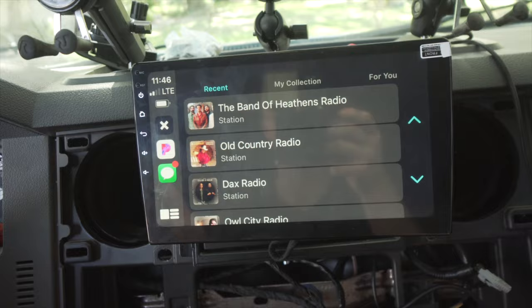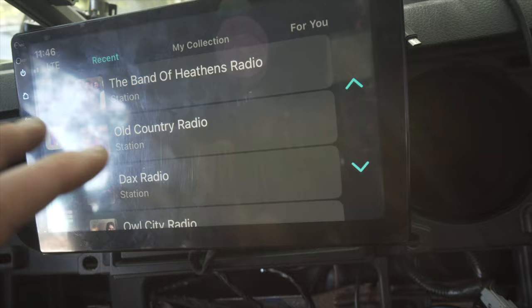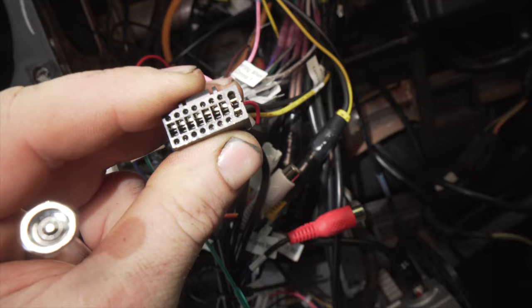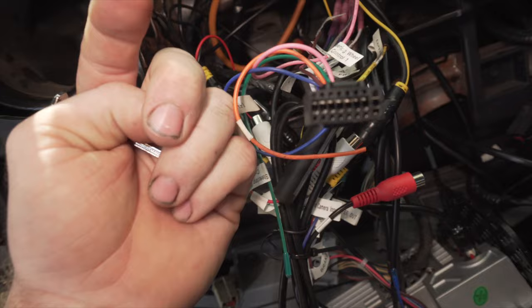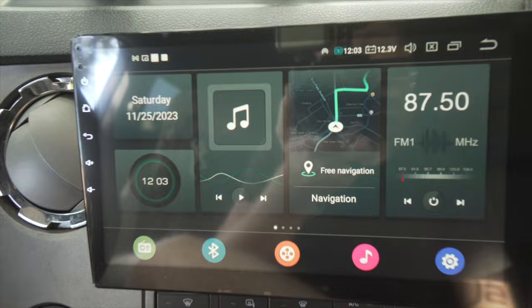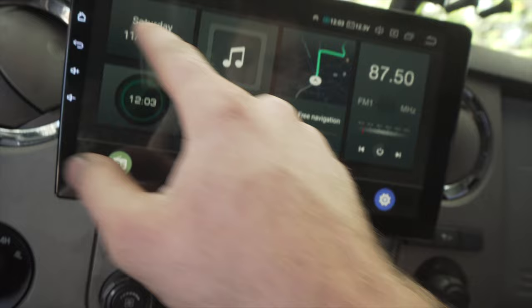I pulled it out and it seems the main plug on the back just wasn't connected well. I may have to bend some of those tabs in the actual plug for a better connection. I'm also going to contact Eonon to see what they'll do — maybe a partial refund or a new wiring harness. I need this working reliably before we're bouncing off-road while overlanding. I bent the power and ground wire tabs a little more so there's more tension when they contact the prongs. Put it back together — hopefully this fixes the issue. But now it's freezing up — are you kidding me? It went out again.